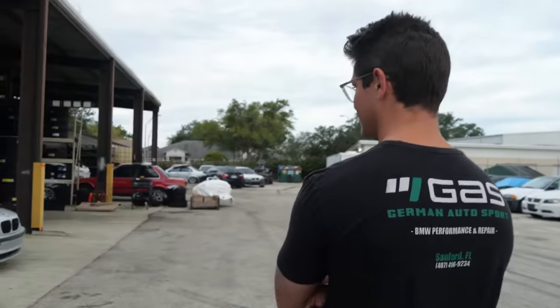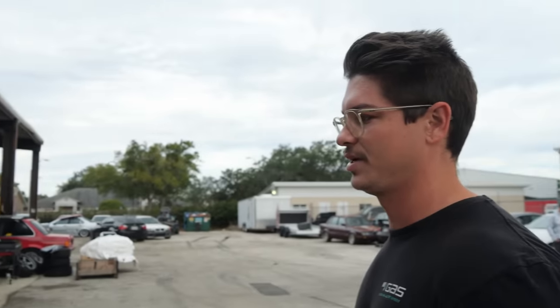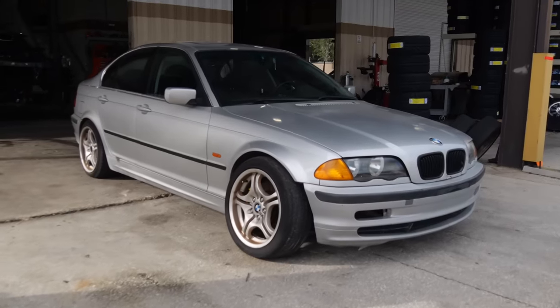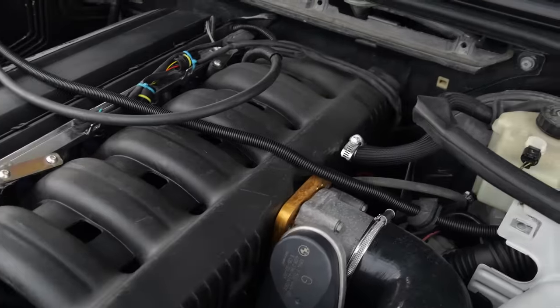So you've got a couple options for us — mostly E46? What do you have for E46? Duarte might be interested, let's just look at it. This is kind of standard of what you'll find here on a resale — basically an affordable drift car that has seen the proper parts. This car is fitted with a ZHP driveline swap with the FDF Ultra Mantis kit, BC coils, 330 rear end. The automatic axles are stronger. It has a stage three-four eBay clutch, M50 manifold done right with a ported head. Something like this is in the six-to-eight range, given all the parts and time — engine-out reseal, the thousand-dollar Achilles oil pump upgrade, welded-in baffle in the pan, rear main seal done, driveshaft serviced, rear subframe reinforced, all bushings done. A car like this, you just get in and drift.